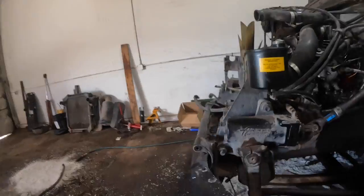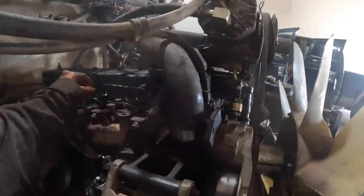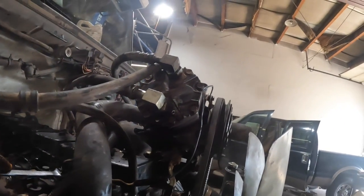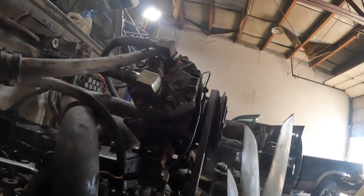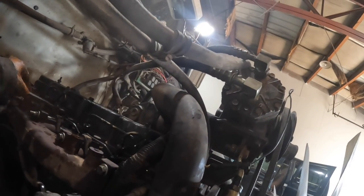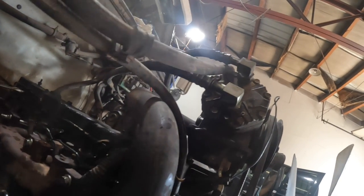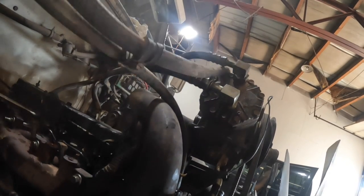Okay, is there any fuel coming out of them other ones? Hey, there is smoke there. That is a very positive development. I got fuel out of pretty much all of these here. It's probably worth tightening these up. I didn't crack the front one and the back one, but I don't know if I'm going to have to, or I don't know yet. That's a good sign, though, that we got fuel, and that there's smoke. I don't know what it's going to do when it runs.